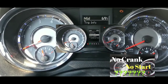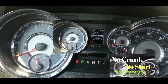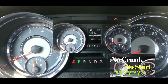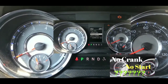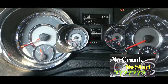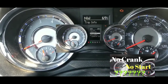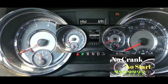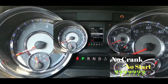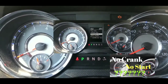Technically what I could do is go out and try to bump the starter with a long crowbar. If you guys can figure out where the starter is, take a long crowbar, take a crack at the starter a couple of times to loosen up whatever components are stuck, and then try to turn the car on — sometimes it works, sometimes it doesn't. But I'm not going to do that right now because I don't have a long enough crowbar. I could also run a wire from the battery to the solenoid terminal to see if it cranks — if it does, the starter is okay. But I don't have the right setup for that right now either.